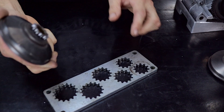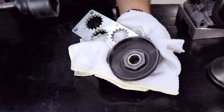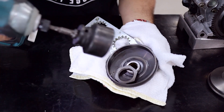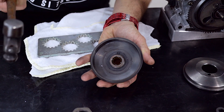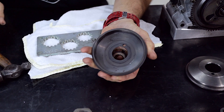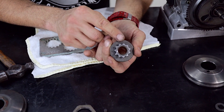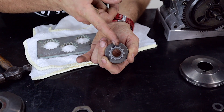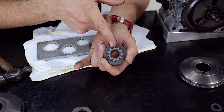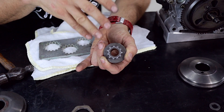To remove the nut, place the clutch drum with the sprocket attached into the smallest cutout on the plate, which is the 11-tooth position. Holding the clutch drum and the locking tool, you need a 38mm impact socket and an impact gun. If the sprocket is locked into the old clutch drum and it's too tight, just get yourself a small hammer. Watch out for the dowel pin — you don't want to lose that. Just tap that out and you're left with the 11-tooth sprocket. This one is still in serviceable condition. When the sprocket's worn out, the teeth will become sharp and start to lean, and then the rate of degradation increases significantly — you can lose horsepower, chew up chains, chew up sprockets. Make sure you keep an eye on your front sprocket, chain, and rear sprocket to keep them in as fresh a condition as you can.